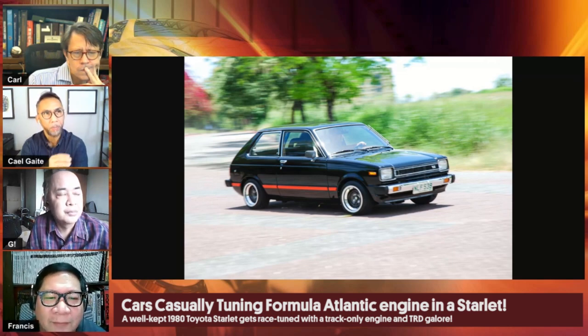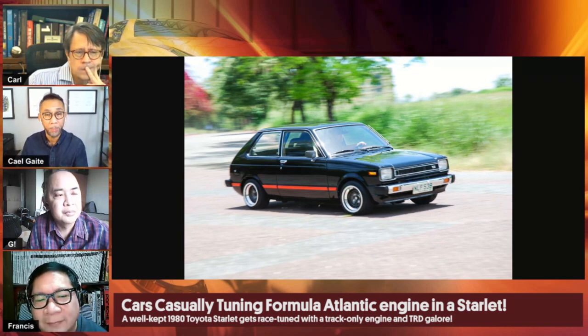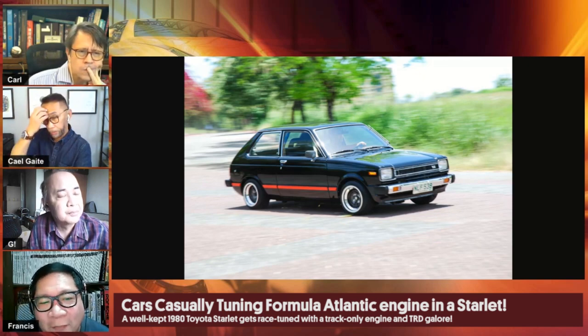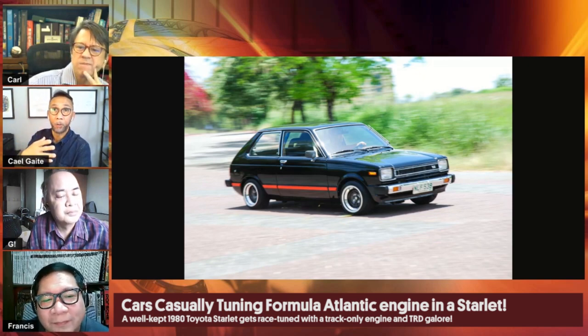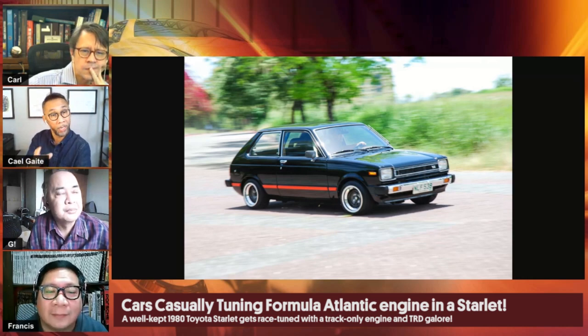Here's the thing with Toyota. A lot of their parts were off the shelf that you could pick from other cars. They shared a lot of components, so manufacturing made it simple. A cross member from another make, you could bolt onto another car. So that made swapping components super easy. And they didn't have any electronics involved. For example, a fuel pump or electric fuel pump is fairly easy. I had a Corolla DX with a 4K, and you could put a 2T engine in it without changing the cross member or the engine support.